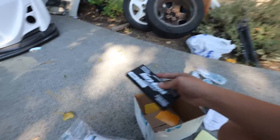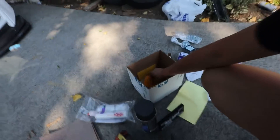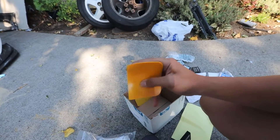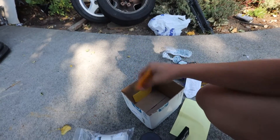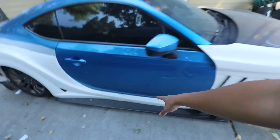The next thing we're going to need is guide coat spray. This is going to make sure that all of our body work is smooth and flat so people don't see where the hardware is — it'll be perfect and seamless. You're going to need a sanding block — any size is good, but I like this small size because it fits in your hand better. Get a hard block, don't get the soft blocks, because that won't get your panels straight. We're also going to need some spreaders — this flexible one for curves and edges, and this one for super straight body panels.